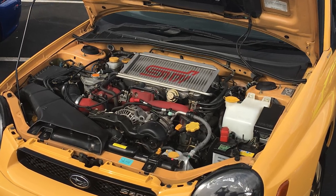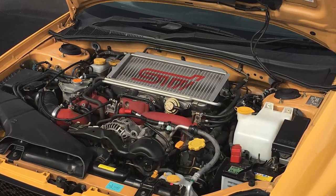There's also something called heat soak, because the intercooler is sitting on top of the engine. When the car is moving and you've got a lot of air flowing through the intercooler it's not really much of an issue, but when you come to a stop and there's no air movement — especially on a hot summer day when the engine bay is hot — the intercooler is going to be hot. You'll have to get the car moving and get air flowing over the intercooler just so it can start doing its job efficiently. In terms of power, it is possible to overrun a top mount's capability. If you're trying to make a lot of boost pressure, it's very possible that you could be heating the intake charge to the point where the top-mounted intercooler just can't keep up and cannot sufficiently cool it down.